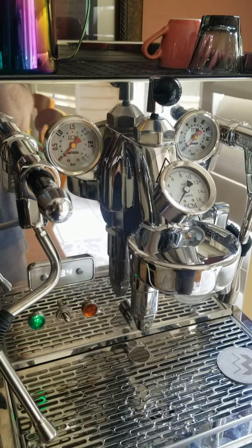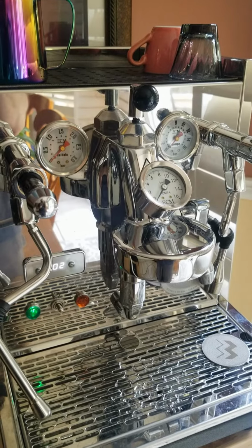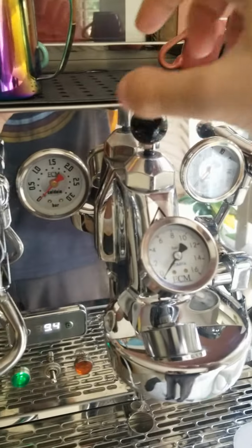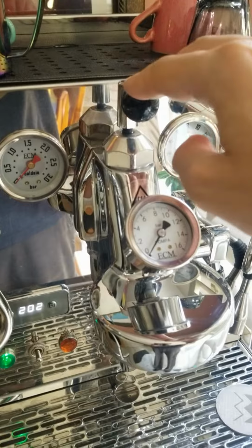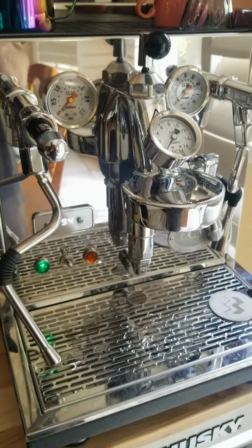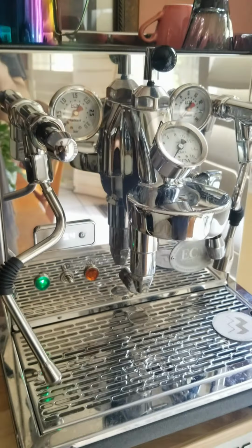It should get the water down to like 2 or 3 grains hardness, which should be okay, but maybe eventually some little bit of scale built up, and the first place you'll notice it is there. So I cleaned it out, haven't noticed a problem since. It's been like a year. Seems to be consistent flow, so that's good.